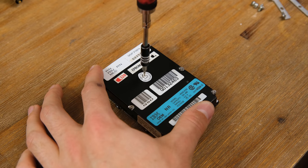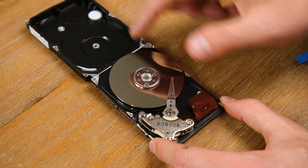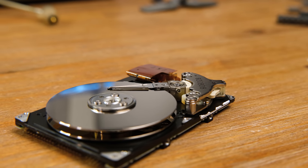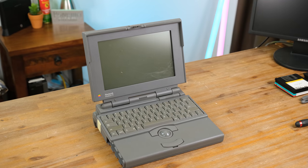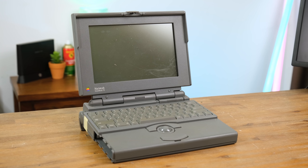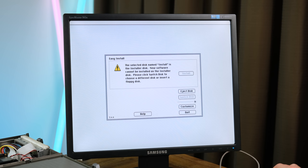But I'm not giving up yet. It's time to open up the original drive that was inside this laptop. Previously I managed to revive a 30 year old laptop hard disk by moving the heads which seemed to have been stuck — the hard drive heads are small copper coils at the end of the arm that move over the magnetic storage platters. But even after moving the heads a bit they still wouldn't move. There was however another broken PowerBook I could pull a hard disk from — the PowerBook 170. While older, it does use the same SCSI hard disk interface. It's only 40 megabytes but unlike the other two drives this one clearly spins up and you can hear the heads moving. But once again the system did not recognize the drive.